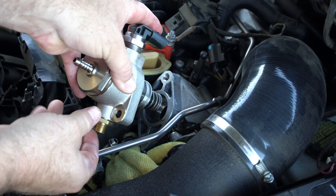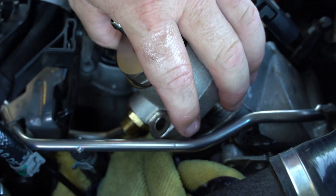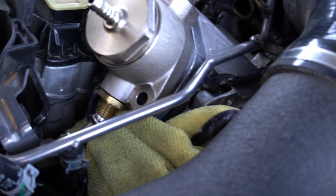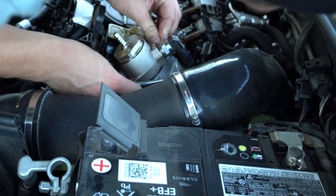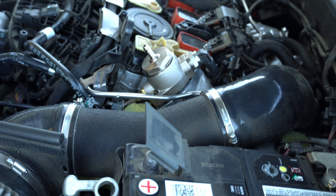You're going to need two people for reinstallation. Put the pump on and orient it so the brass fitting is facing towards the right side - counterclockwise, like how we pulled it off. Then take your finger and bend the solid line so it fits up into that brass fitting. Once the pump clocks into position, that fitting will go right into place.